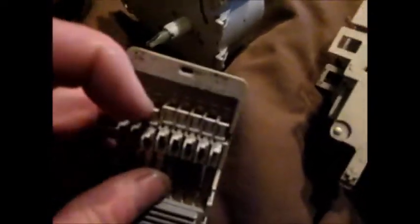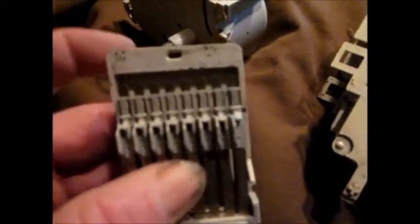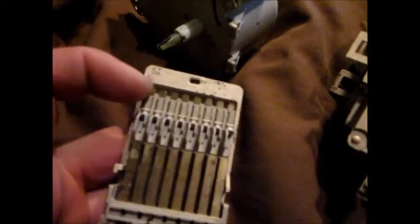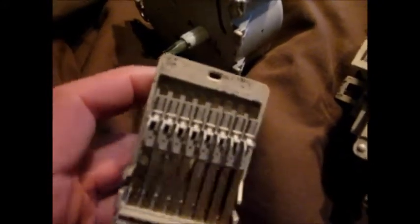You have to be careful — it's kind of tricky. You don't want to bend the points too much; you just want to see if you can get a piece of sandpaper in between the points that are burnt. I wouldn't mess with the other points that don't look burnt. Usually you can see a noticeably dark area — on this one it does not have it because this is supposedly a good set of points.